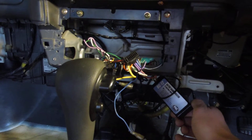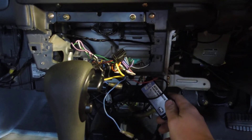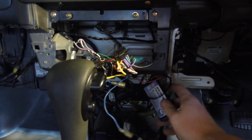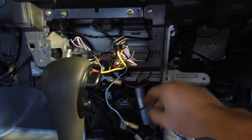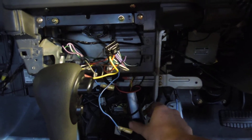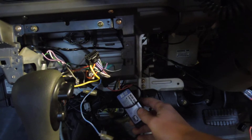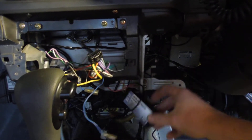Now if you're wiring up a voltmeter, we've decided to wire it after the pack module, because by that time we want all power to be cut so nothing's drawing. But if you don't really care about that, you can always wire in the voltmeter first so you can see what voltage the power is and why the remote lines shut off. For more information on this, check the build playlist and I go more in depth there.